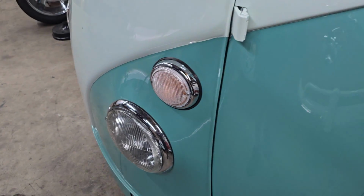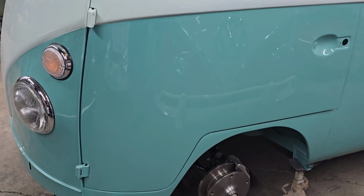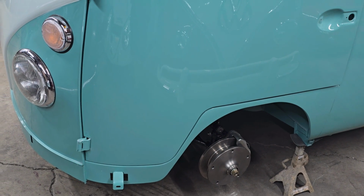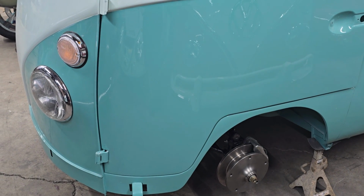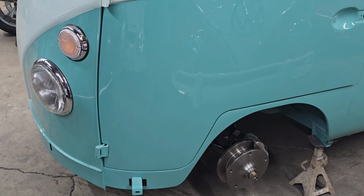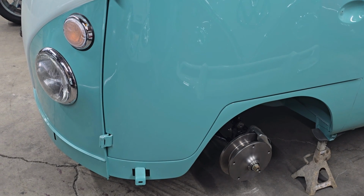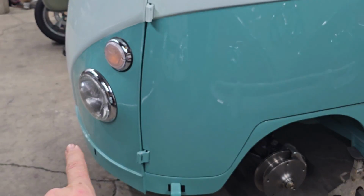And then there's a separate shift rod which couples with that one and then actually runs up to the shifter. So I installed that one, and I put on one of Washburn's Delrin bushings on that, and it took some work to get it to fit nicely on the shift rod hanger. It just wasn't fitting in there and able to open fully. It was pinched closed, and it wouldn't let the shift rod go in. So I spent some time massaging both the shift rod hanger and the Delrin bushing to get them to fit perfect. And then I went ahead and installed the forward shift rod.